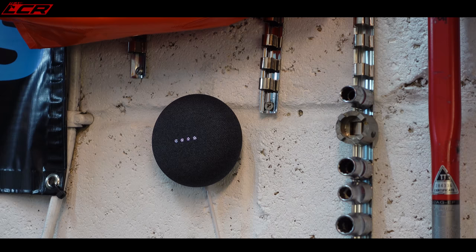I didn't show that on the video. I've since ordered the gasket, but I was missing a gasket on the rear. You need to have that gasket. Someone sent me some pictures of their 690 whereby they didn't put the gasket in, so it was blowing around that joint and it actually melted their petrol tank — they were leaking fuel. So you must fit that gasket in between the two systems where they mount, between the header and the tail pipe. I've now ordered it. Thanks for pointing that out — I'll point it out to everyone in case they followed that video and they're about to melt their fuel tanks. Don't do it.